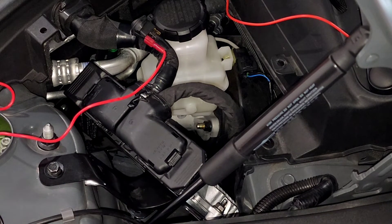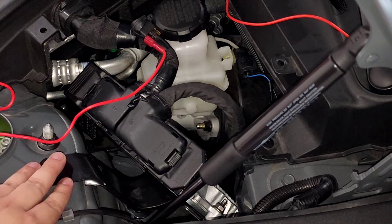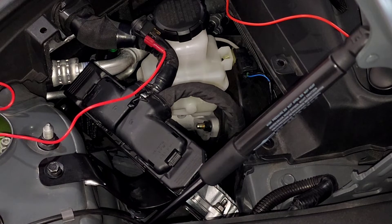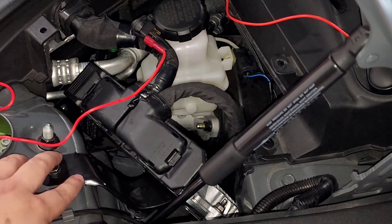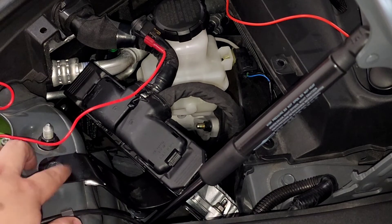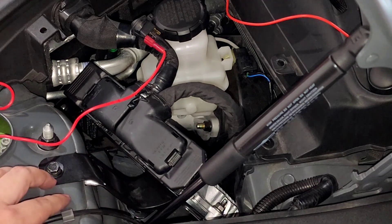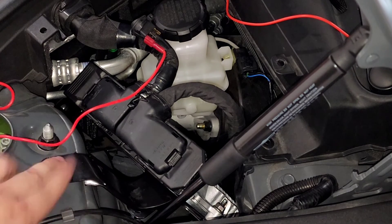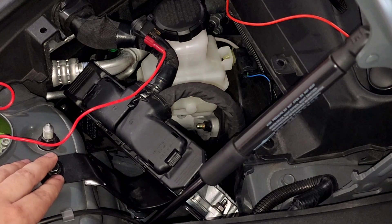I'm going to organize the wires, re-tie-wrap them, fix the Velostech wire, and then fire it up. If you have any questions or comments, drop them below. Two main takeaways: the one closer to the engine is your TCU; the ECU is in the compartment where you remove the cover. Key note two: remove the whole ECU with the bracket using two bolts and one nut — the whole thing comes out and it saves you a million times over. Hope you guys enjoyed the video, thanks for watching, Boost the Whips out, have a pleasant day and God bless.